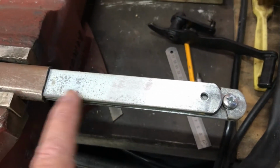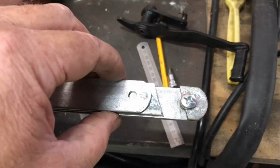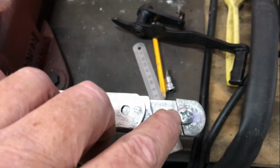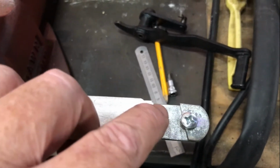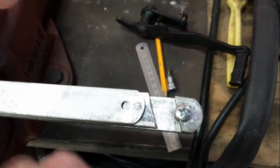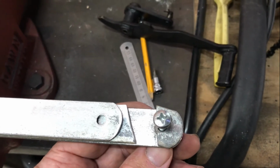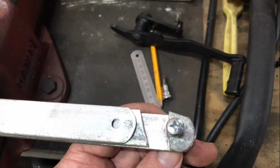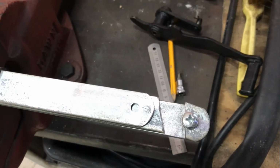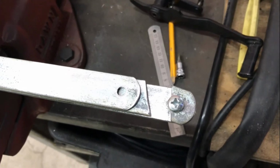As I said, these are very long at the moment, enabling me to manoeuvre things around, but I've cut those angles to try and match the slope on the pedal. They're not both the same because the pedal's not parallel at that point, and this bolt will sit up and go through all three layers, so it won't be in the way of the pedal like it just saw. So I'll put that bolt in there and tighten it up with just the pieces like that.